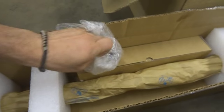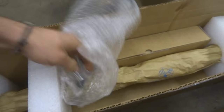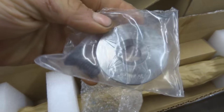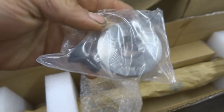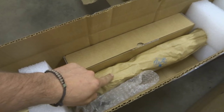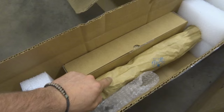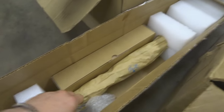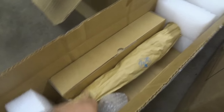It's competitive. Diesel stuff is more expensive, but you can see this retainer here. It's kind of cool, he's got this machined out with his logo. I like that. And this cam is also tapped already for the retainer. If you saw earlier in the video, I showed you us tapping the cam that the other guy sent, because he doesn't send them tapped for a retainer, which is also somewhat ridiculous. But there's that. I'll put it in and show you guys how it runs in a later episode.